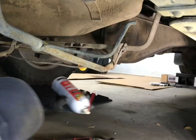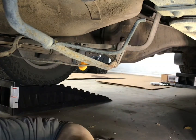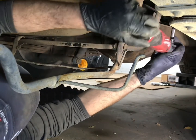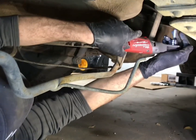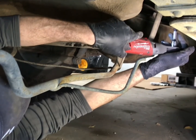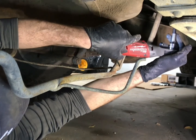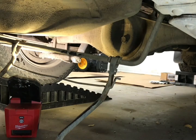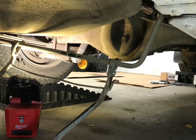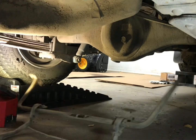I'll put the tire over there. Now I'm going to spray everything with PB Blaster so I can get some of these 12 millimeter bolts out a little easier without breaking them — just using the cordless ratchet to get them started. Hopefully I'll be deleting this bar, the spare tire carrier from underneath, just to give me some more clearance, basically, because it doesn't really fit now that I've got the hitch on. Instead of trying to make it fit, I'm just going to put it on the outside. I did break two of the bolts but managed to get it out.